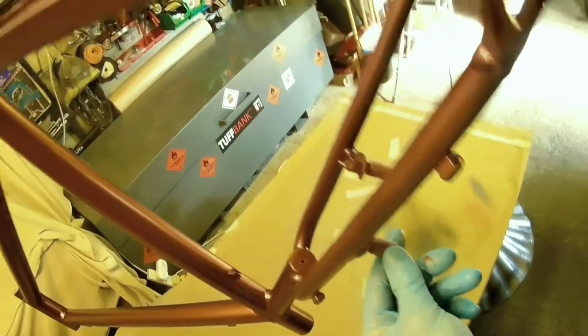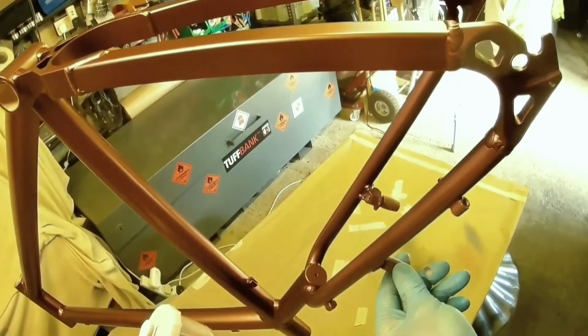But I always find that the smaller you make the fan pattern, the more difficult it is to control the fluid, and the more difficult it is to get an even distribution. So I tend to leave a wider fan than is needed. Obviously you get some overspray, but if you're not putting loads out, you're not overspraying too much, so you're not wasting too much material, and you're not making too much of a mess of your workshop area.